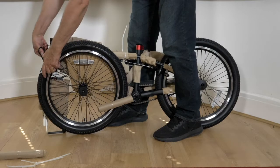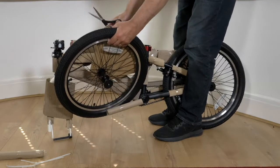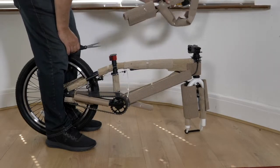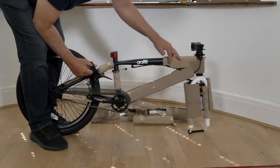Building your bike: cut the cable ties on the front wheel to detach the wheel from the frame and put to one side. Cut the cable tie on the handlebar and move to the front of the bike. Use scissors to remove the packaging, being careful not to cut any cables or scratch the paint.